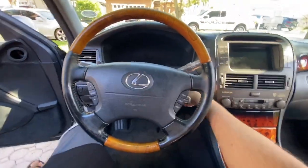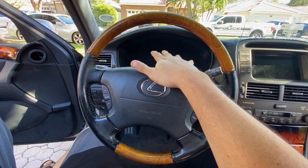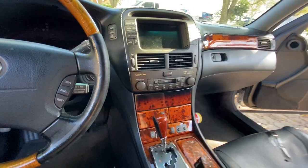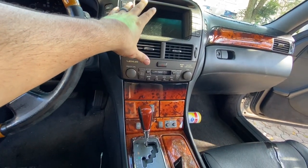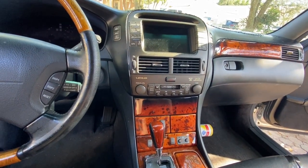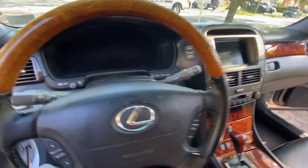The reason I did that is because when I put it in the off position, the steering wheel does not go back to its original setting — it stays down. By doing that too, you're cutting power to the radio and navigation system, and in case wires touch or pinch, you don't blow a fuse. So let's start with that.